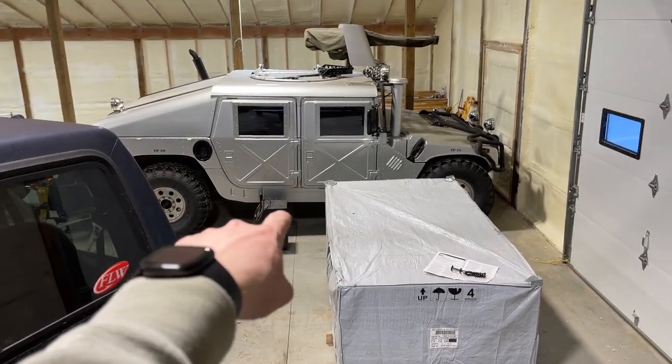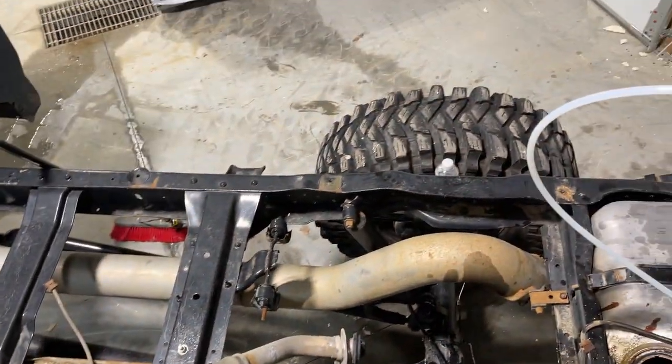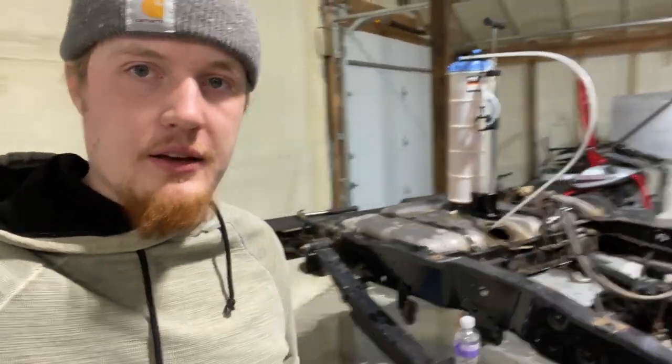That's where the car lift is going right there where the Humvee is — we'll even be able to lift up the Funmins, and this thing's on 10 inches of lift and 40s. We've got basically all the fuel out of the tank — just loaded with gunk on the bottom, so I think it's definitely our issue. I'm going to pull the tank — it's a lot easier to do with the box off. I just have to pull the straps off the top and bottom, then get some diesel detergent, hose the thing out super good, let it air dry, and soak the end of the pickup tube in some diesel detergent too. Thanks for watching, guys — we got the Funmins pulled out and the tank sucked out. Making progress — see you in the next part.